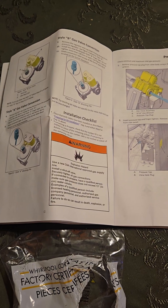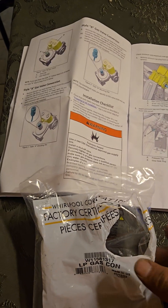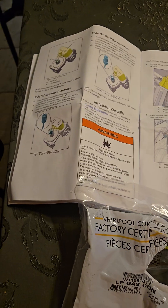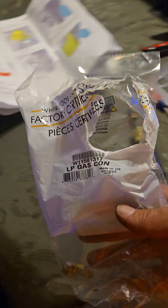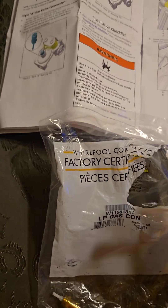I'm going to put the sticker on the burner — you should do that after you convert it, so if a repair guy comes out or if you resell the dryer, they can see it's been converted. I like to keep the factory OEM parts, bag them up, and put them somewhere safe so when we sell it I can give them to the new owner.